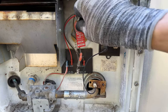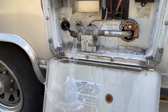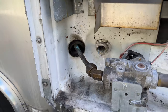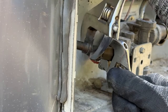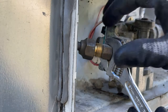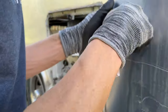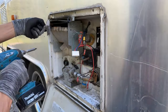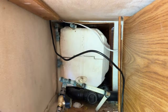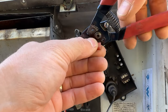You're going to want to lift the lever on the hot water pressure pop-off valve, and you're going to want to take out the drain plug to drain the tank completely. Next you can disconnect your propane — it'll take some elbow grease to get the fittings loose. Now we can remove the old unit by cutting around the flange with a razor knife and cutting through any old caulking holding the unit onto the trailer wall. Remove any screws holding the old unit in, then go inside the trailer and cut any existing plumbing preventing the unit from being pulled out the side. Cut the wiring harness and leave yourself enough wire to easily reach the back of the new unit.